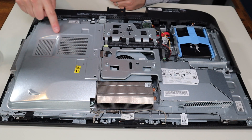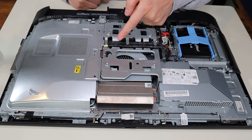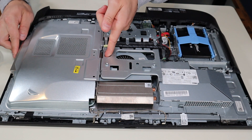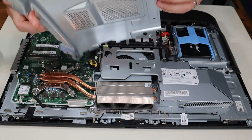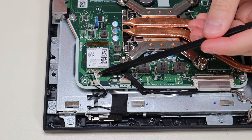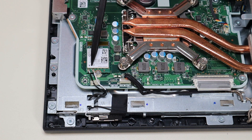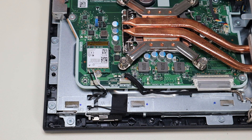Right here you have this metal panel to access some more components. Again, no screws — this is a very nice computer to work on. There's just a pull tab here. You push that down a little bit and then slide it that way and that panel comes right off pretty easily. This is your Wi-Fi card here. The Wi-Fi card is held down by a single screw, and once you undo that screw you can pull it out of this port. After that, all you have are these antenna wires that snap onto it — those are just snaps. They pull directly up and off of the Wi-Fi card, but you do need to have them at a perfect 90 degree angle to snap them back down. You are strong enough to damage them if they're not at the right angle and you try to force it. So just be slow and patient — it can be a little bit of a pain if you're not used to it, but you will be able to get those back down.